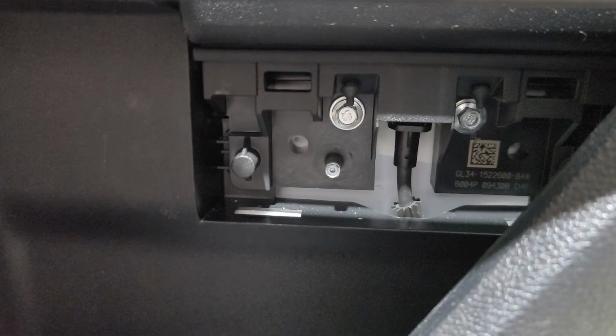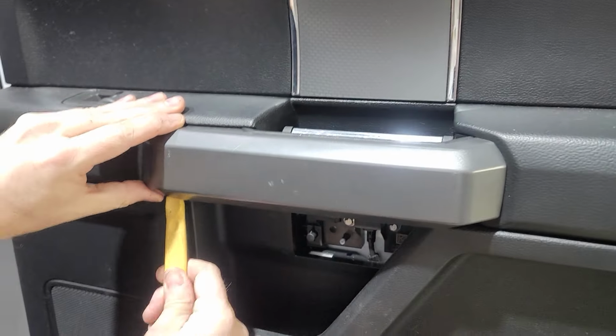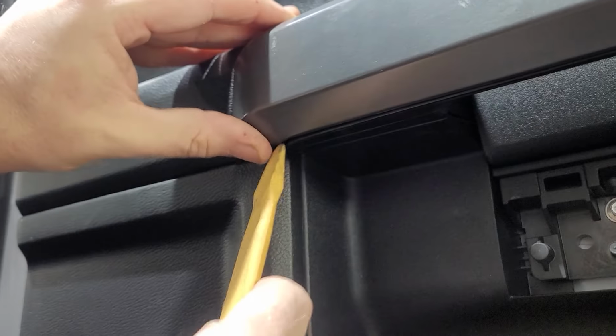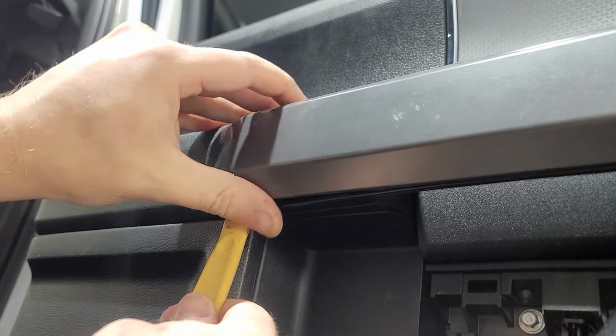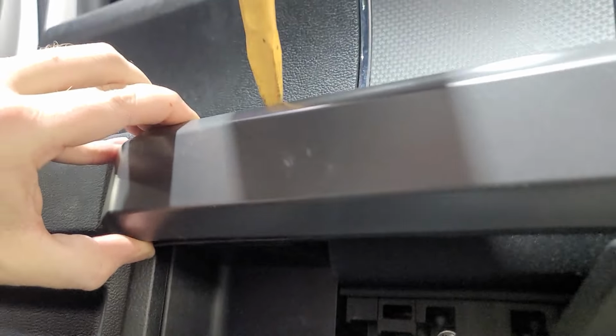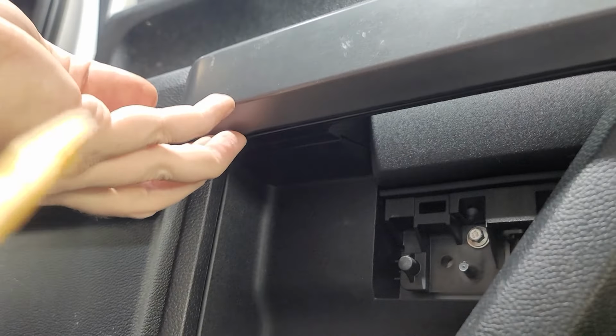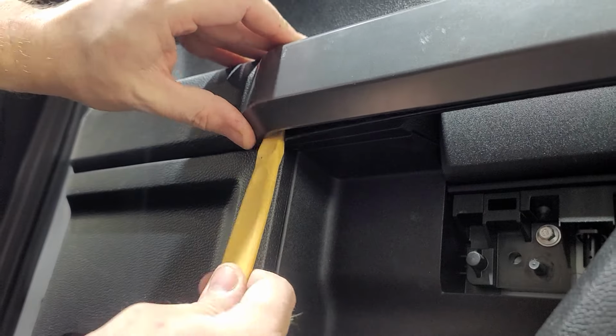And then inside of there, you have 2 7mm, I believe. Yeah, they're both 7mm in these trucks. And then underneath here, you're going to have like an indentation. I think it's on this one, that side right there. And then you're going to start prying that with your plastic pry tool to be able to get that out. This side. Every one of these is torn up. Every customer I have, they always have the dents and scratches all up in them and torn all up. I'm going to start wrapping these and selling them because people's are always damaged and torn up.